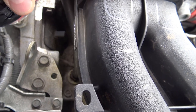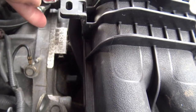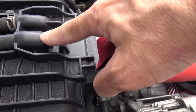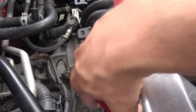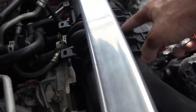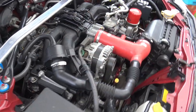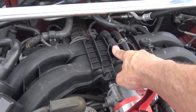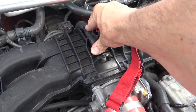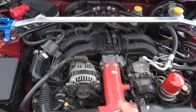This tube comes out of every motor in some different place, so all engines will have this. This tube is going to go around, come up here, and go right into your intake. So what they do is take those vapors collecting in the crankcase down below and put those vapors back up into your intake manifold. This is the intake manifold on the Scion FR-S.